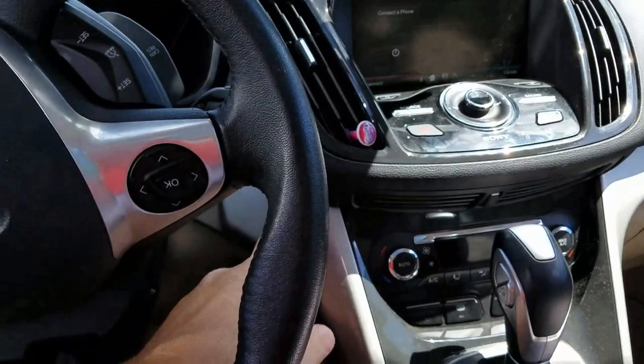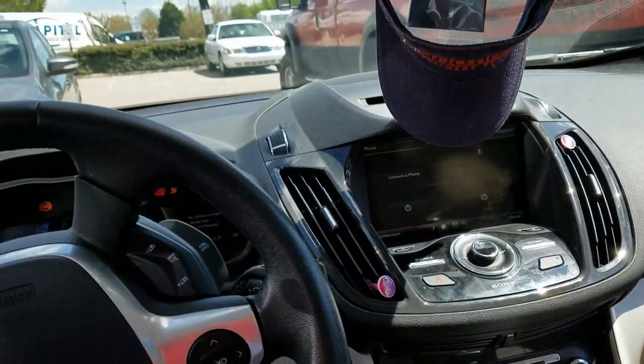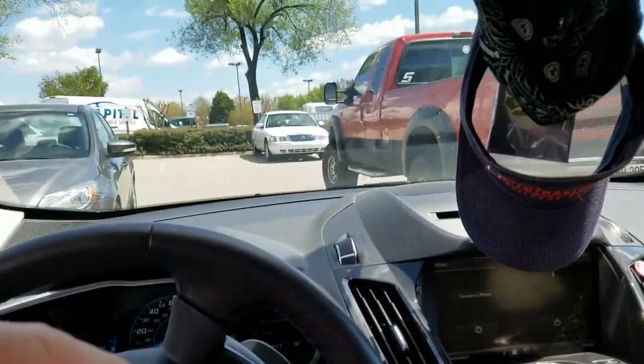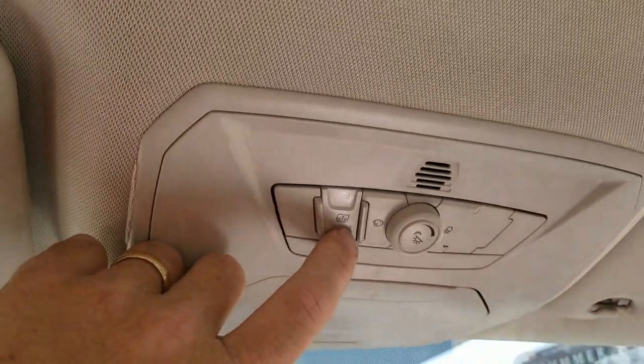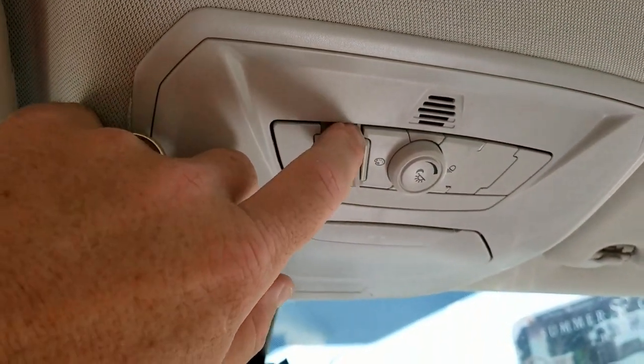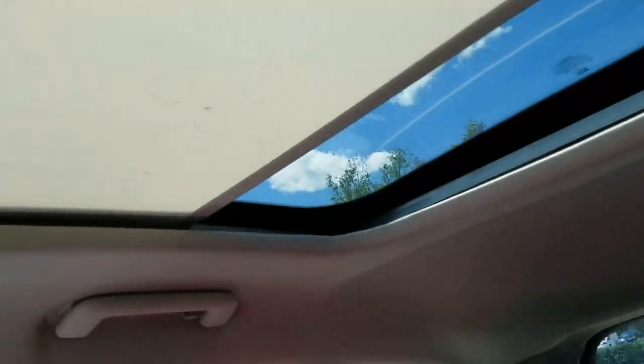Let's turn the car on. This is a hybrid so you don't hear anything. Alright, chimes and everything — all the proof-out modes for all the indicator lights. Alright, here we go: one, two, one, two — now hold this one. It's shut. Hold this one, it's going to shut all the way. I'm holding it. As soon as it shuts, it's programmed. Boom, let go.